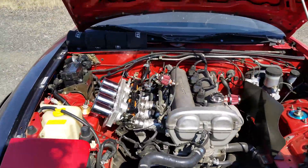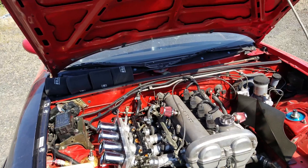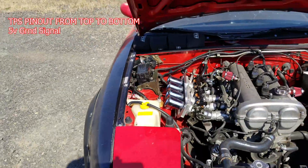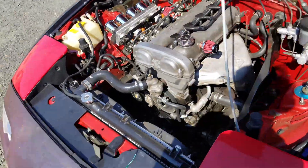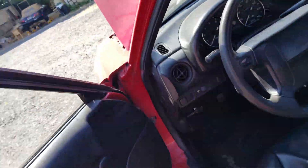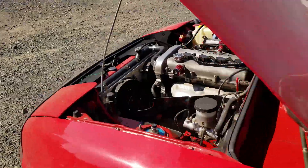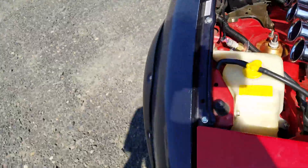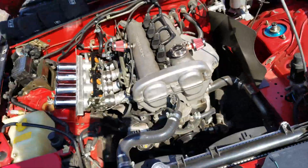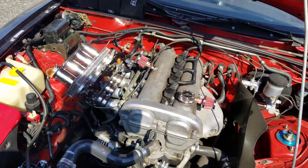Just to give you a rundown of what sensors are managing this engine: there's a GM one-bar MAP sensor, a Suzuki GSX-R TPS sensor — a VTPS sensor essentially — an AEM AFR 30X gauge, a GM intake air temperature sensor, stock coolant temperature sensor, stock oil pressure sensor, and Toyota coil-on-plugs for the coils themselves.